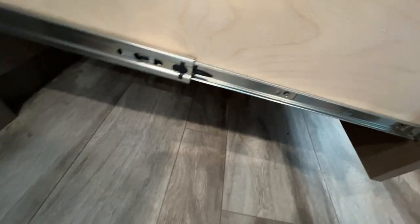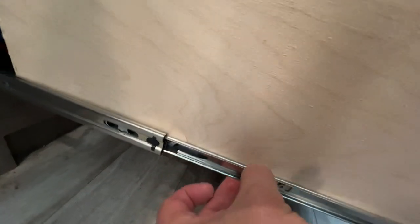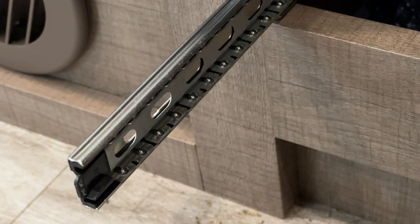The pump for your fresh water is underneath the stove. So what you have to do is pull the drawer out from underneath the stove, and then you will find the pump and the extra hose that allows the pink antifreeze to be loaded into your system. Just take these out. There's these little tabs here. You lift up and it allows you to remove the drawer. You want to be careful not to disrupt these little bearings that are in the slider arms.